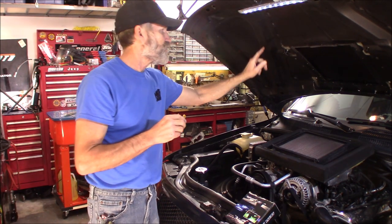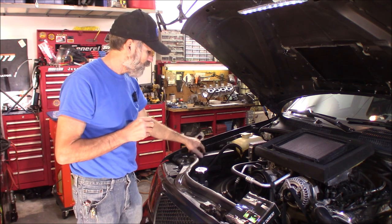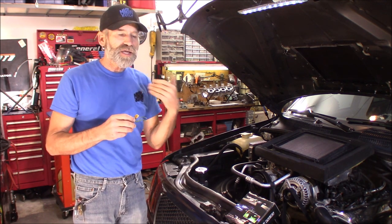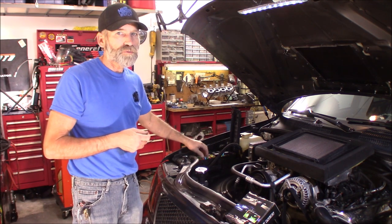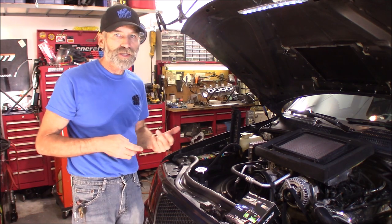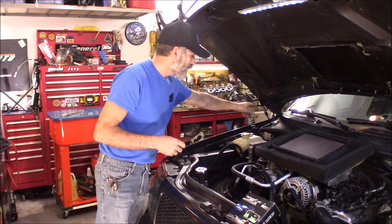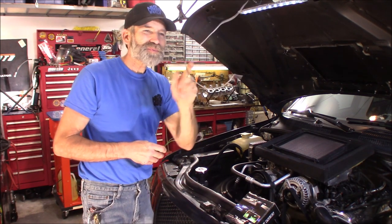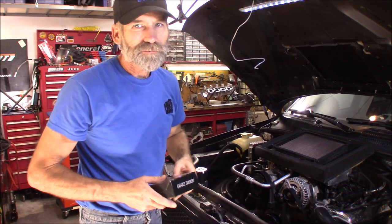Then I got the wiring run down inside this channel right here inside the hood, coming out way down over here, and then it leads to the power supply or your battery fuse block. I used one of the existing empty fuse slots. If you lift this cover up you'll see several positions that are not used — I did a video on how to use these spots, I'll put a link above. Now we're going to run the wiring in a different path, down this way. I've already added it in here, and we're going to have one of the LEDs located here with a couple more off to each side.